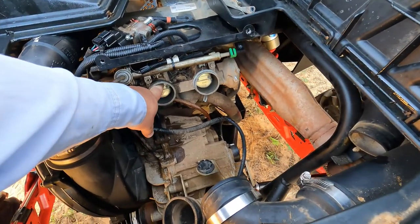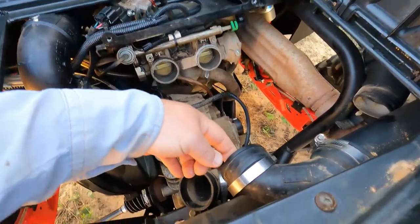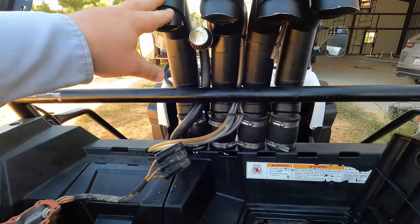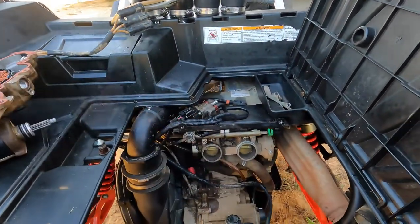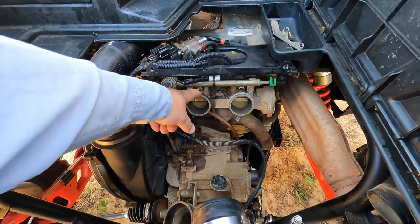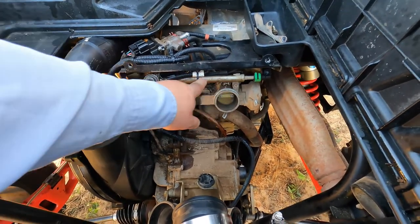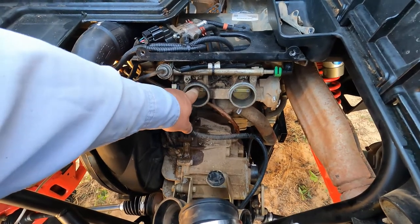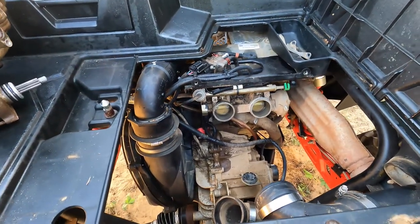Basically, when you hit the throttle, that opens up, takes air in through the air intake, which is where your air filter is. In this case, the air intake hooks to all these different air channels, tubes, whatever. They come up here, so if you were to take this into deep water, you don't get water into your engine. These air intake deals are called throttle bodies. The fuel injectors sit right up here. Here's the fuel tube. Your injectors will inject fuel right behind these butterfly valves. As you let air in, it mixes with the fuel, goes into the cylinders, like a regular combustion engine.